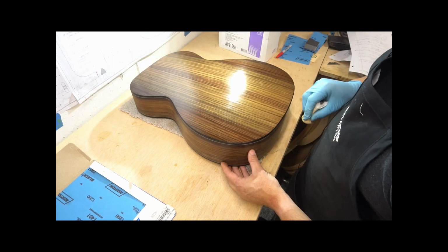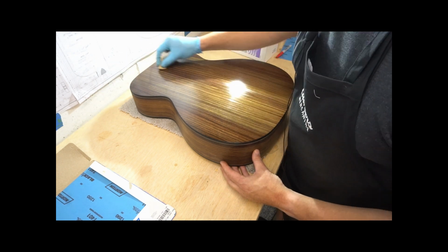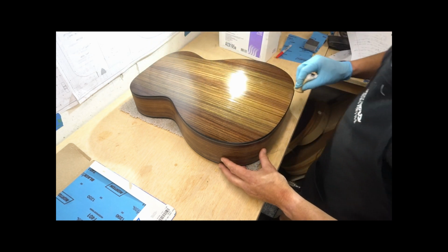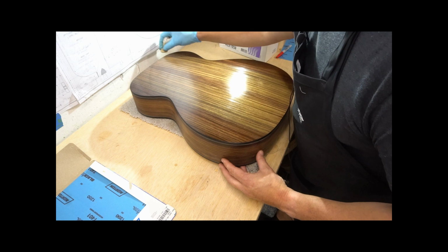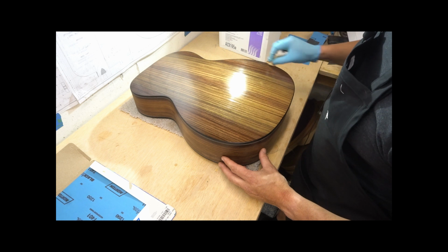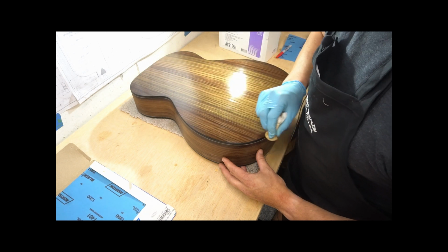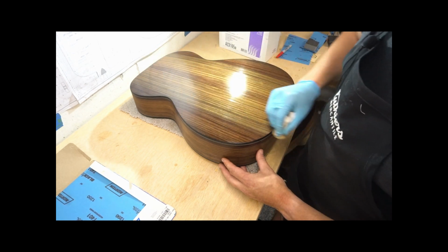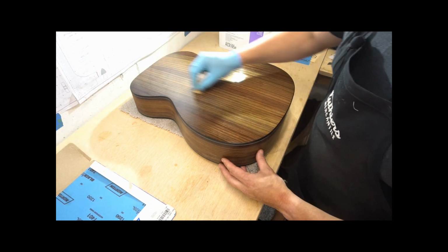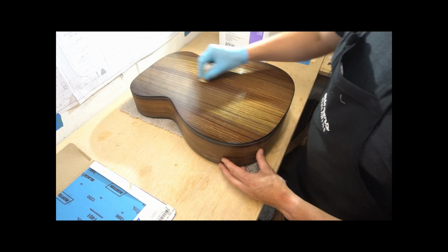And if you used a little bit, if you were able to get a nice compact burnish in your polishing stages earlier, in your leveling stages, then this might not take very long. Maybe you can get away with one or two. But 3 to 5 is not unheard of. Okay, I can feel this pad starting to dry out. And I'm getting a little less haze in here, so it's clearing up a little bit.